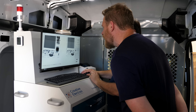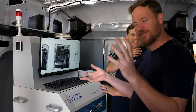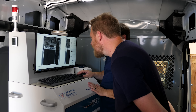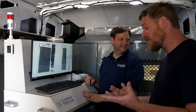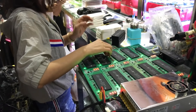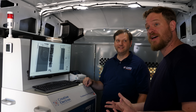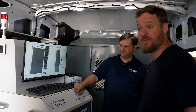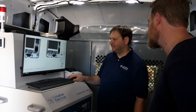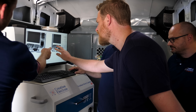No obvious wire rework or anything. This is like playing that game where they give you two pictures and you've got to spot the ten differences. The batteries are pretty different too. I couldn't tell you which one is the genuine one — batteries are a huge issue. The testers can change the serial number and manufacturer information on the chips on the battery. So one of the things you can also tell is where there are missing screws. You used the screws right there — these two.